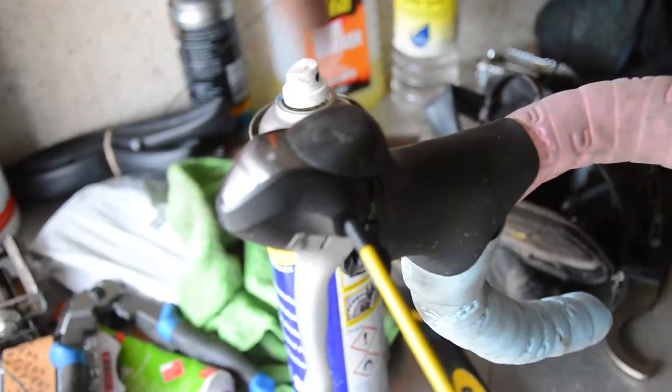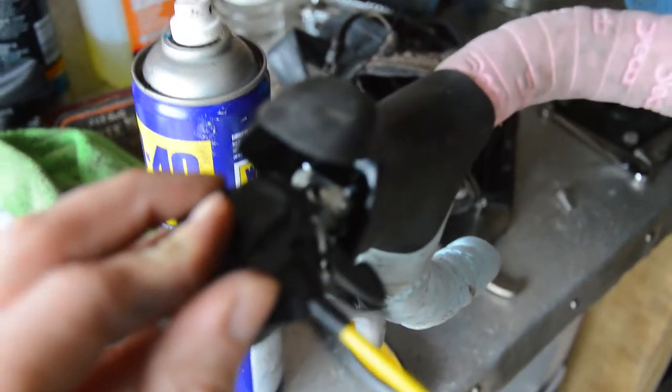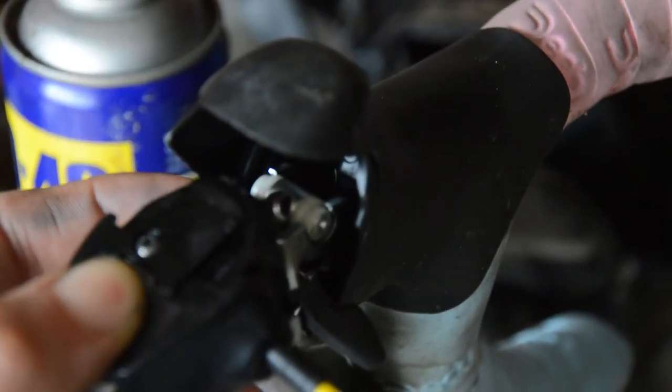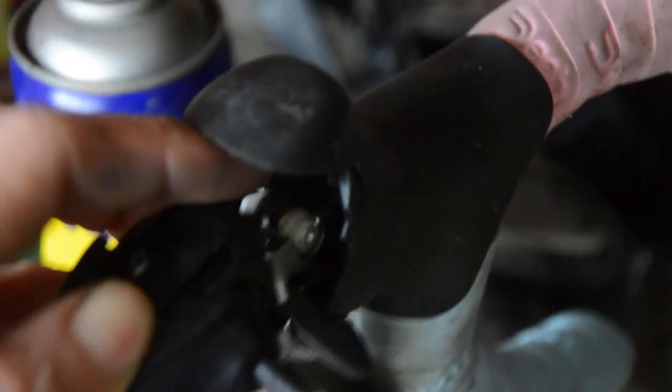Found the best way - I need to take this lever off because it's all strapped up already and it's difficult to just feed the cable directly in. So I take the lever off, poke the cable through and into there. There's a sort of stopper that the cable goes into - I can actually take that out, which just makes it a bit easier to find the hole. So I feed that through and then work on adjusting the brakes at this end.